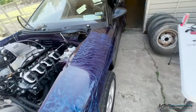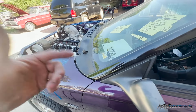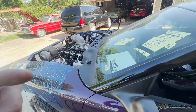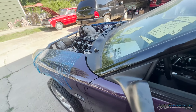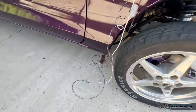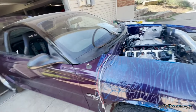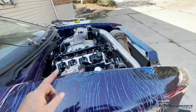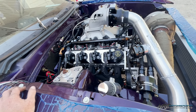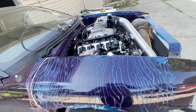Yeah, it's the converter touching the flex plate — it doesn't push back in far enough. The torque converter actually touches the flex plate, and that's the noise you're hearing: the flex plate turning, catching the converter, metal on metal, trying to spin it. It actually spun the converter a little and spit some fluid out on the ground because I don't have the lines or anything hooked up. I've got to get that sorted out, go get a belt for it, get the alternator wired up so we can start it and it'll charge the battery. Then we've got to start on the cooling system plumbing too.